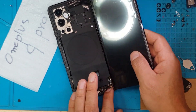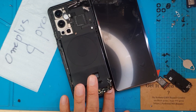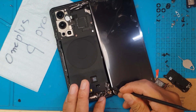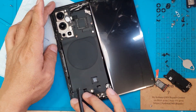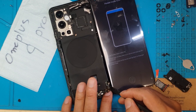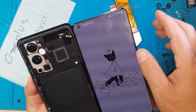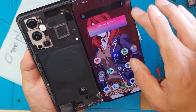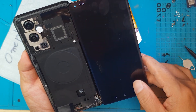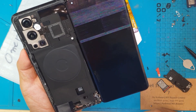Right here we can test it — we can attach it without fully disassembling the phone. We're going to push it in, make sure it's secure, and try to turn this on. As you can see, we have a bit of display, and that's not flickering from our studio lights — it's just that the new display is not really seated properly. The connector is working, but the flickering is very annoying and an issue, so we're going to disassemble the whole thing and troubleshoot what's causing this interference.